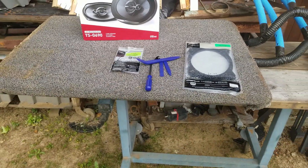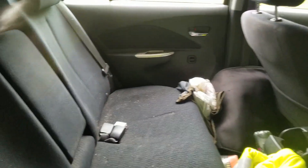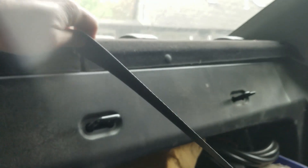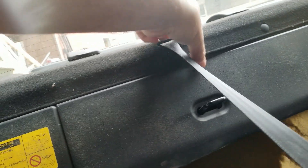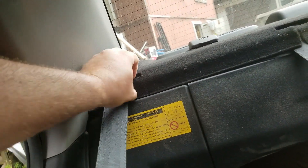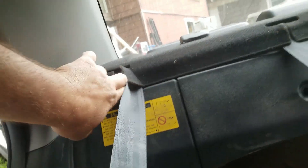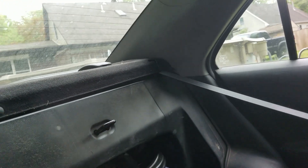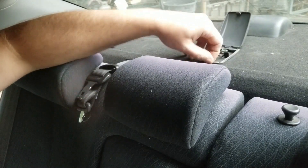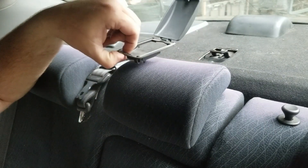To start with, we're gonna want to fold these back seats down. There are little slots here for the seat belt to come through — get that under as opposed to running through. These covers you've got to pop off — you pop the front out first and then pull forward and unhook it. Now these side panels are probably gonna have to come out, left and right.